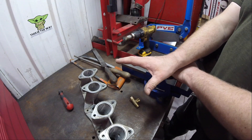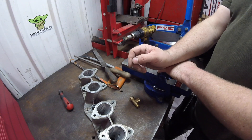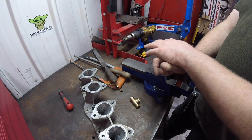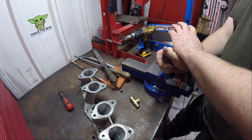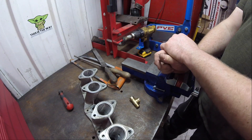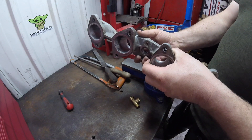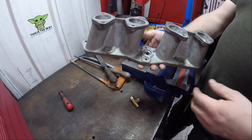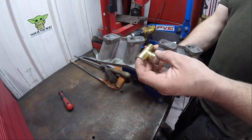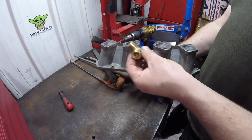I've pulled off the inlet manifold from Will's Escort. We need to put a coolant temperature sensor on the vehicle somewhere — a coolant temperature sensor is one of those sensors we definitely need with fuel injection. It has massive influence on fueling, startup, all of those things. The original car didn't have one, so commonly the Pinto engine guys use this port that comes out from the cylinder head. I ordered a T-piece — this is an FFM, three-eighths BSP fitted fitting. So I ordered this T.